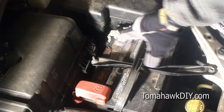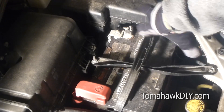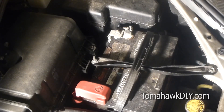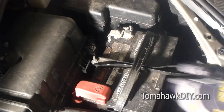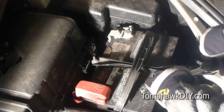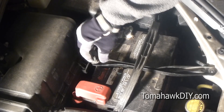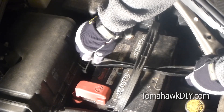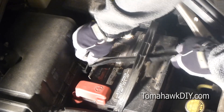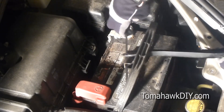Now the first thing we're going to do is loosen the old battery. In this case it's held in place by a bracket with a couple bolts. Most vehicles have some kind of device that secures it in place — usually it's not more than two or three bolts to get it out. So let's go ahead and get that undone. Now that we have the bolt out on this side, this rod is secured in kind of an ingenious way, so you just have to work it down until it unhooks and then you can get it out.